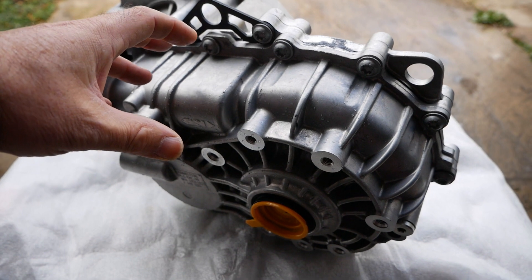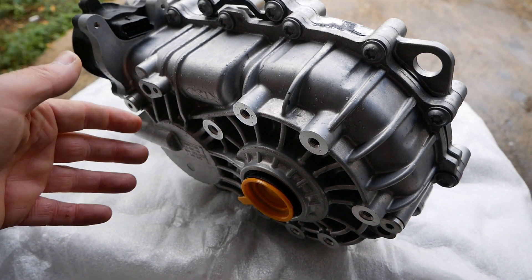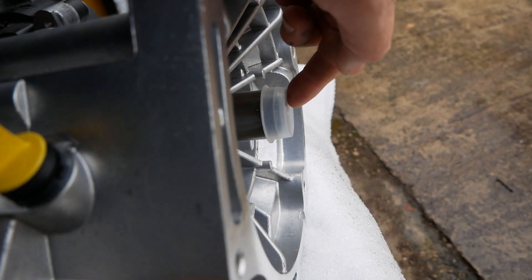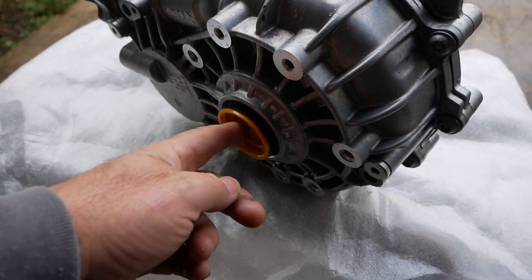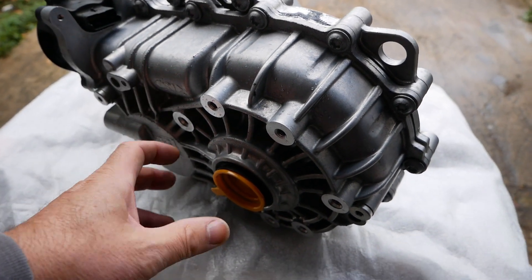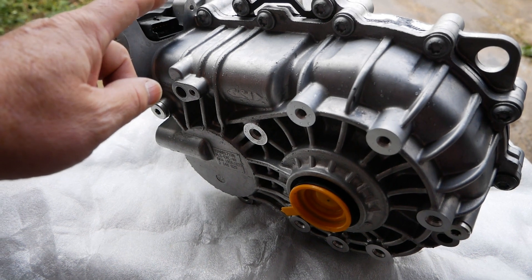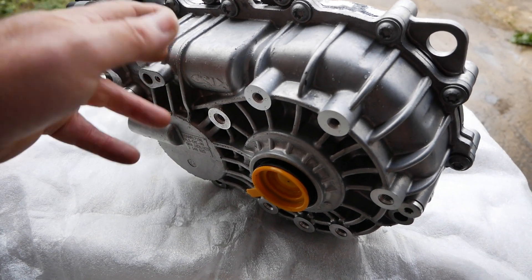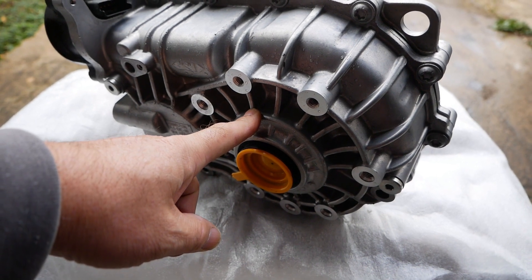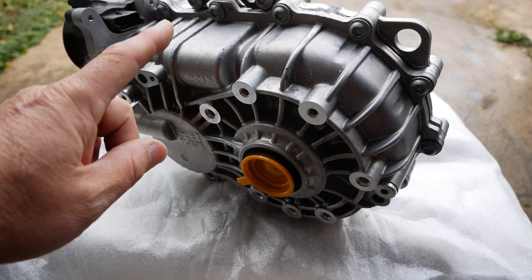This is quite a big lump and is bolted to your electric motor. If you're not sure what a reduction gearbox is: EVs are single speed, so they don't need a traditional gearbox with sliding gears. All this is doing is reducing the speed of the electric motor down through some fixed gears to the two driveshafts. Because there are no sliding gears — everything is fixed — it is just reducing that speed down and should last a very long time. But I think because of the high revolutions and high torques involved, the oil should be changed in these.